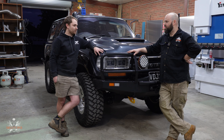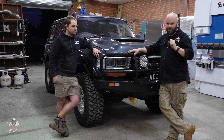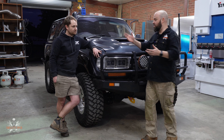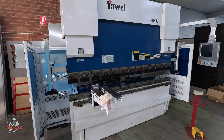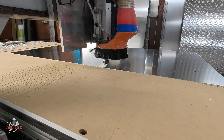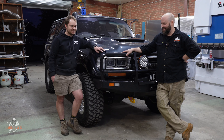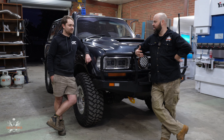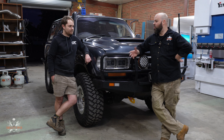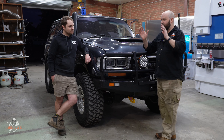To do it well and have no body lift, you've got to get pretty involved - notching chassis rails, clearancing everything. It's not just mounting the engine either: fuel lines are going to be changed, power steering, everything, air con lines, wiring's a huge part of it. Even little things like the oil pressure sensor - that usually sits at the front of the engine facing down, but here it hits one of the cross members. And that's just the 79 series alone - the 200 stuff is a whole different ballgame.